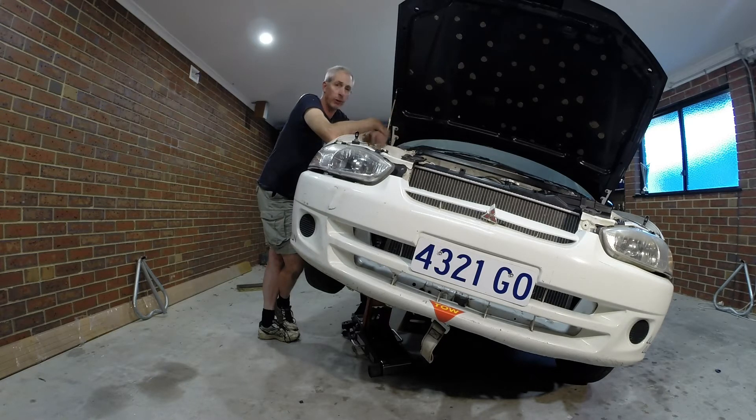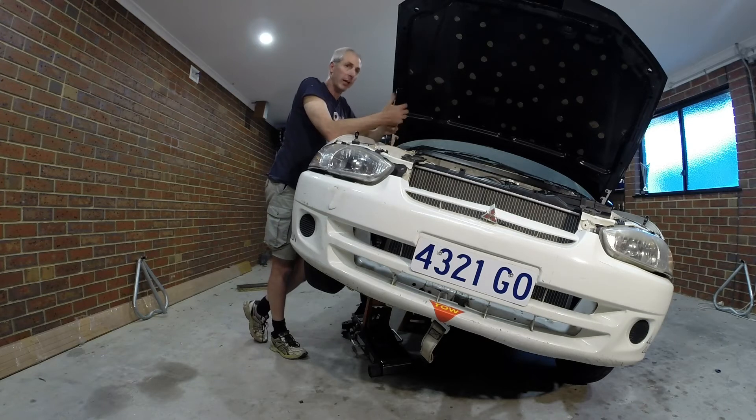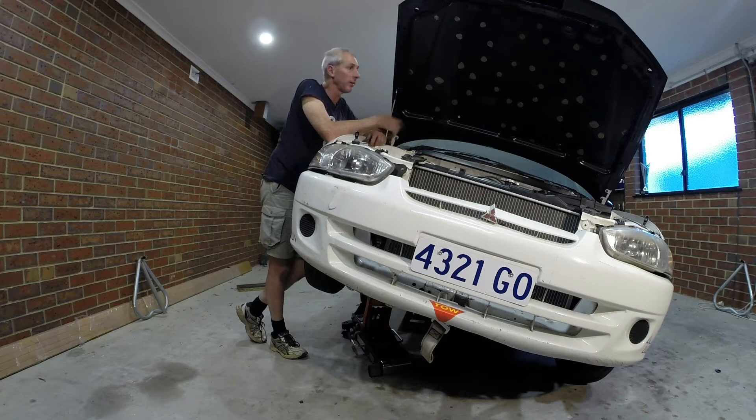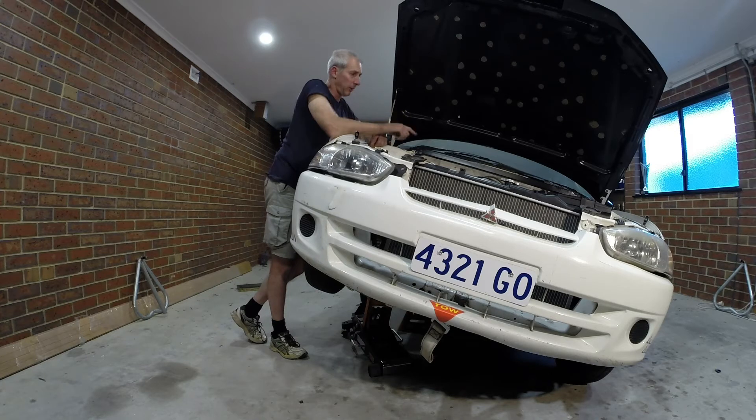But taking into account that we're not having any sort of live load on this - we've not got any cornering pressure on it - it's hard to tell. I thought there might have been some G-force equivalent taken into account by jacking the car up like this - we probably have, it's hard to say. I measured the tyre pressures when the car was standing on the ground, and when all the load was put on one side, I had nine and a half pounds pressure beforehand, and when it was all loaded on one tyre on its own, it had nine and a half pounds pressure as well. So it was marginal - maybe a quarter of a pound pressure difference.